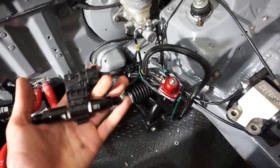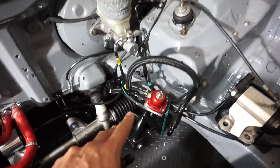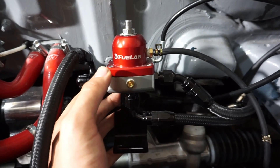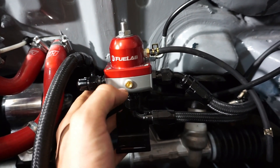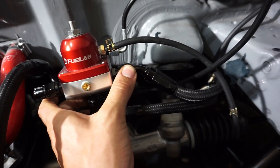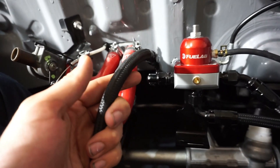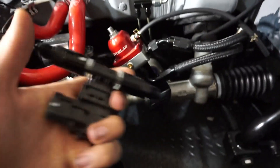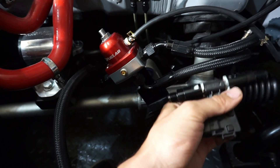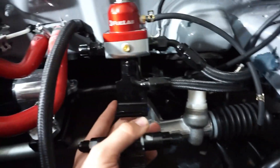We'll start off this install by trying to find a good spot to plumb in the sensor. Taking a quick look at my fuel setup, I've got a FuelLab three-port fuel pressure regulator — I've got a video on how to install this, I'll put that in the description. The setup here is: you got a vacuum line going to my intake manifold, a feed line coming from my fuel pump, a return line going to the fuel tank, and a line going up to feed my fuel rail. You want to install your ethanol content sensor in line with the return line going back to the tank. I've got a couple adapters and some more Dash-6 line to get this all to work.